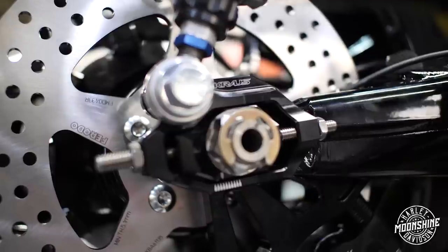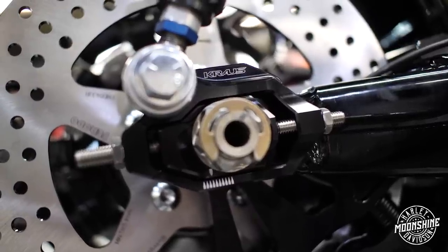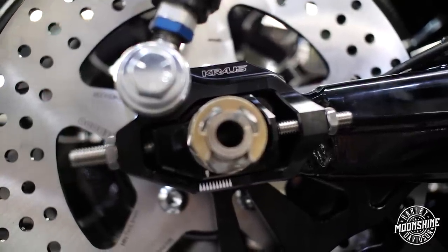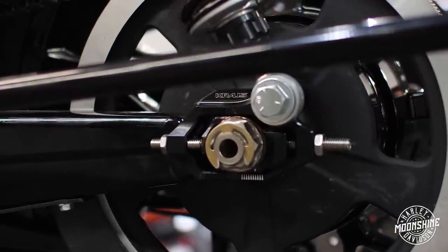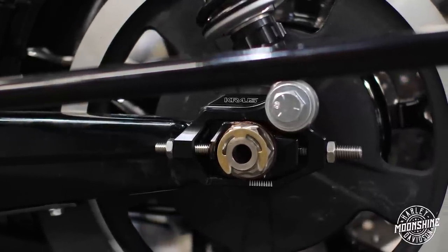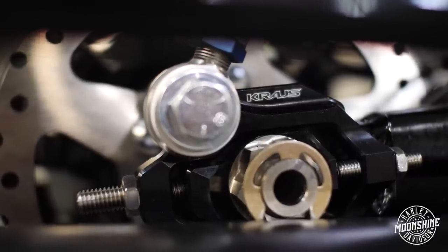Now let's talk about the rear axle setup — anything we're doing that's 145 plus horsepower. When you have 140 plus horsepower and you're hammering on this bike, the rear left of your axle — which is on the pulley side or chain side depending on your setup — will actually pull forward. The cam design from Harley is a great setup and easy to adjust your belt, but from the factory it was never designed to handle 145 plus horsepower. Over time your rear axle gets tweaked, twisted a little bit to one side. To combat that we've worked with a couple of different axle adjusters and landed with Kraus.